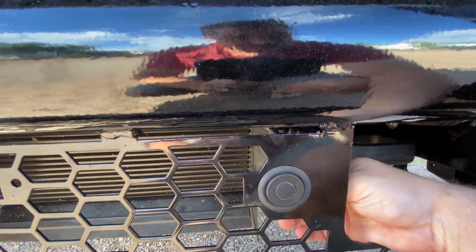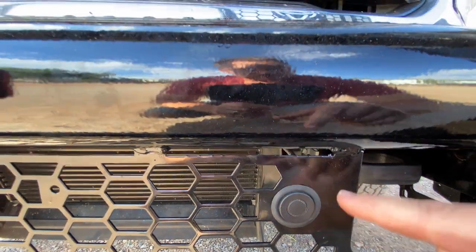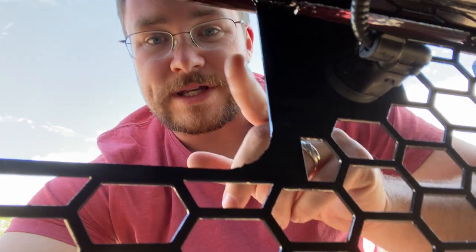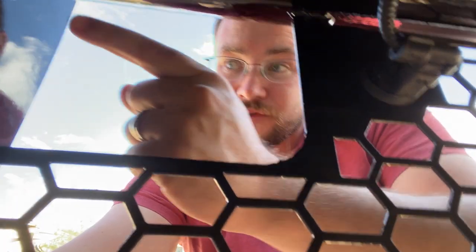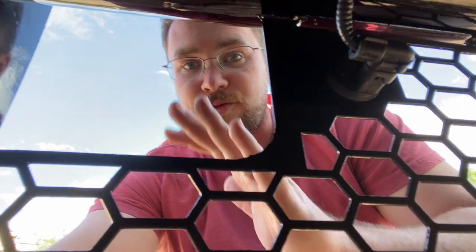When putting these in, you'll have some issues with wiring. You have to make sure that every sensor you pull out of your old bumper goes back into the same location on your new bumper. See this one right here — it's at an angle, attached to the wire by an angle. You have to reposition them to get more slack out of the wiring. There's one over by the fog light — that one is straight across, not at a 90-degree angle, so that one goes behind the fog light. The shop was trying to flip them around, putting the flat one where the angled one goes and vice versa, and none of the wiring was working. If you install one of these, make sure your sensors go in where they came out of your old bumper.